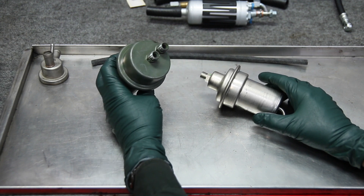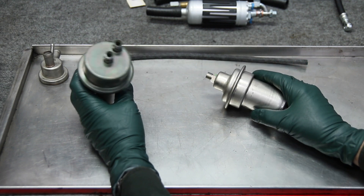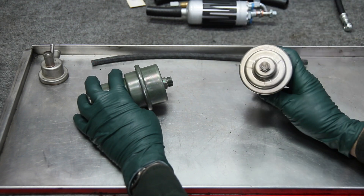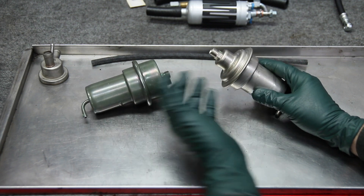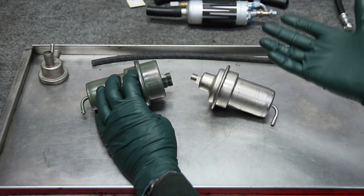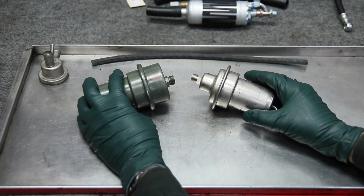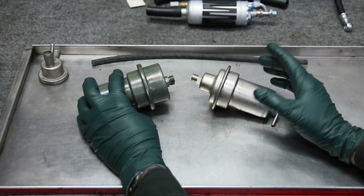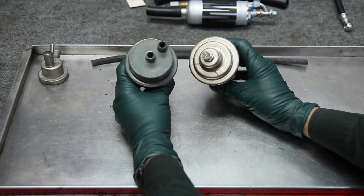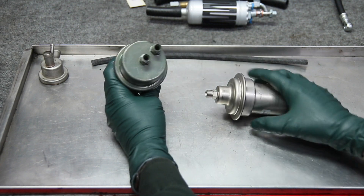When I list these kits on my website, I'll note in the title whether it's a two-hole or one-hole fuel accumulator. The two-hole units were early models, varying from about 1977 to 1979. Single-hole accumulators started showing up in late 1979–1980 and were common through the early 1980s, such as on the 380 SL. Before ordering a FID kit, remove the shroud, get a good light, and look at the end of your accumulator to determine whether yours has two holes or one hole.